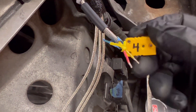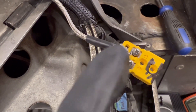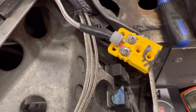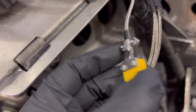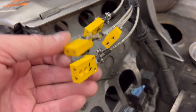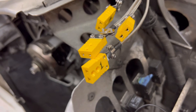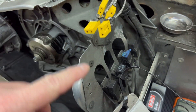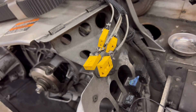I'm labeling mine with the cylinder numbers so I don't get them mixed up. This is what it looks like just before you're done — you have your seals run back over your shrink wrap, and the shrink wrap is holding your braided line in place, then you get the cap on. Check for continuity one last time. Final connection with the wire support bracket installed — last thing you do is check continuity and you're done. All four are done, different lengths corresponding to different cylinders matching the pattern on the engine. Now I'll mount my MoTeC E888 expander and make the female connectors that plug into it. Hope this helps somebody — if you like this stuff, please leave me a comment. Thank you.